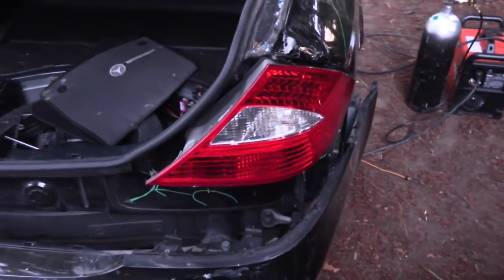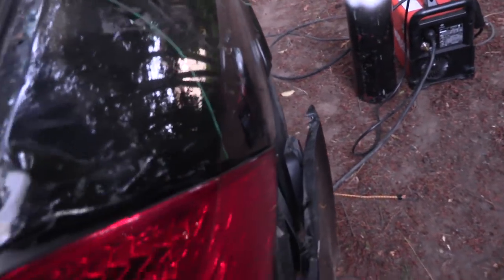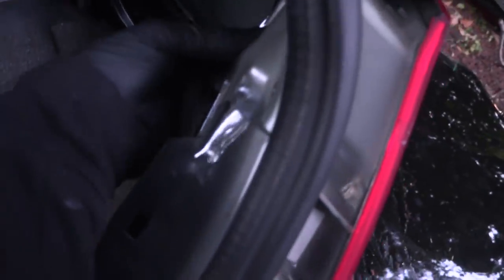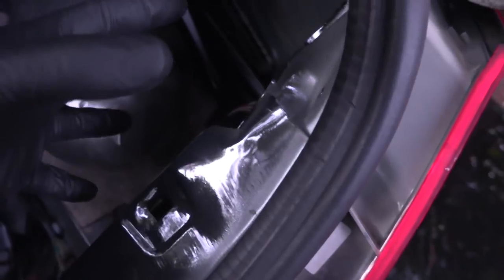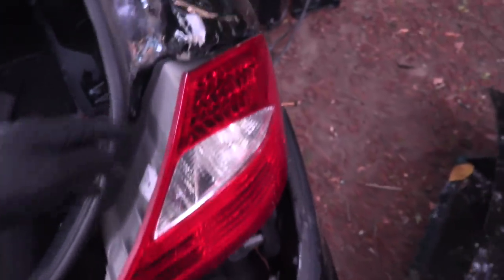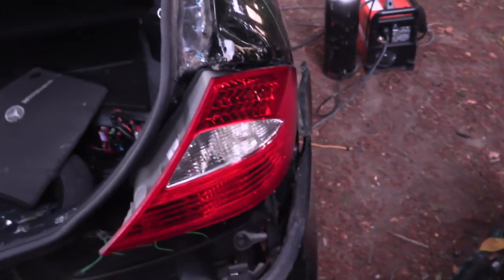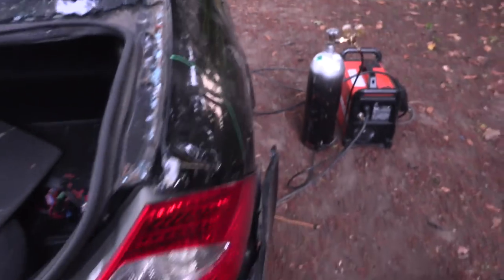As you might expect, the tail light housing is a little bit worse for the wear - it looks like it took the brunt of the impact. I was able to kind of get the tail light to suck in over here and coming around here, but the bolt-up parts right here and down here are pushed in a little bit too much - about a half an inch. I'm going to have to get in there with a hammer and hit the stuff back out a little bit, and that's the same thing that'll have to happen on the other side. Over here we're going to do some paintless dent removal to pop that out as well. I really want to try one of those Harbor Freight kits. I think I want to work on it in the daylight, so I'm going to work on that tomorrow.